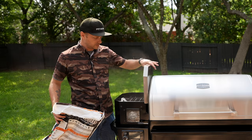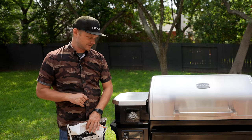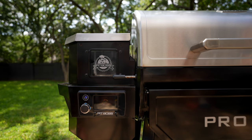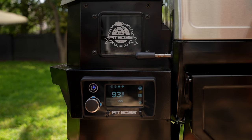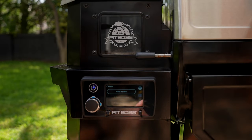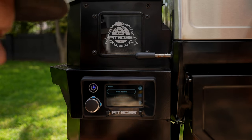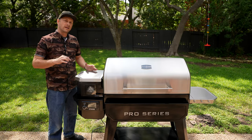With the hopper loaded up, I like having a glass sight so you can actually see that there are pellets in the hopper. I'm going to plug the smoker back in and hit the power button. Now we're going to want to prime the burn pot. With the touchscreen interface you're going to see this menu button, and then we're literally going to touch, hold prime, and that auger is going to spin for two to three minutes.